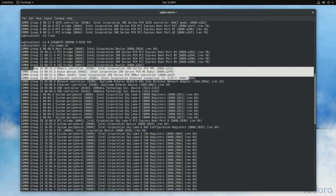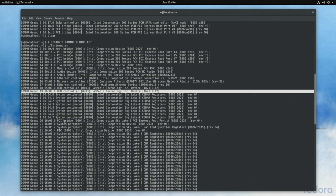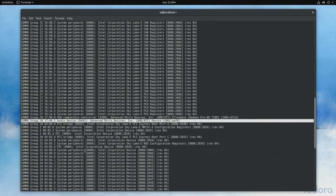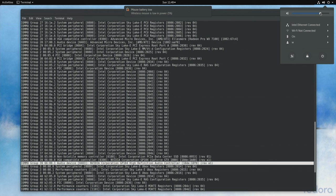For the IOMMU groups, basically everything is in its own IOMMU group. This is really great news. So if you're going to buy one of these and use it for virtualization, well, not with the Kaby Lake X, there's not really enough PCI Express lanes. But even the peripherals through the PCH, through the chipset, seem to do a good job isolating those. So nicely done, Intel. This would make a fine work and play machine, at a premium price, of course. A fine work and play machine with these IOMMU groups should be pretty good for virtualization. This is going to be part of our upcoming coverage of Qubes and IOMMU testing on the Linux channel. Be sure you're subscribed to the Linux channel for that.